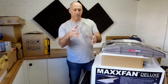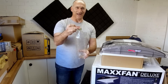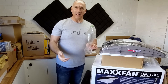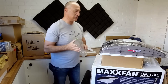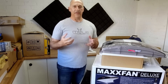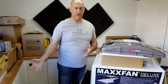I'll give you a simple example with this bottle. Let's say this plastic bottle — imagine this is our van, all sealed. I'm going to suck on this bottle to simulate putting the fan on extract. You can see exactly what happened there: there's nowhere for the air to come from to make up what you're trying to get out, and it produces a vacuum that wants to crush the bottle. That's not going to happen to your van walls, but you need to provide adequate air coming back in so the fan can actually work, otherwise it will stall and just inter-circulate within itself.